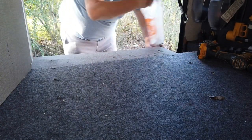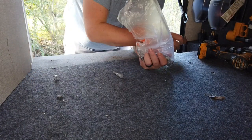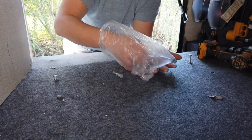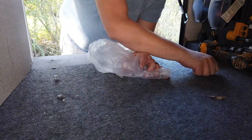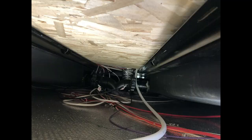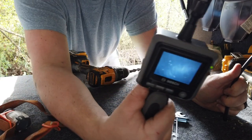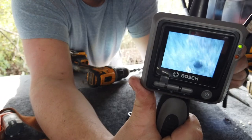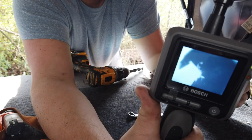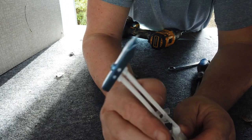Spoiler alert - apparently you can guess where my black tank is. When I tried to put the carriage bolts down they just weren't going into the holes like they should. The ones sticking up the worst actually hit the metal supports that hold the black tank up. This left us grimacing and wondering if we actually punctured the black tank. So I used a camera scope to look down in there, and you can see the top of the tank - no hole there. Catastrophe averted.